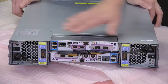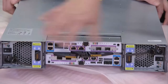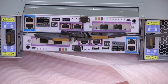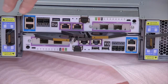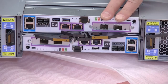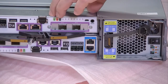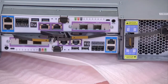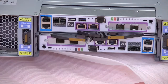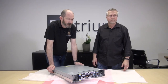So this is the business end — this is the connectivity. We've got dual controllers, dual networks, dual power supplies. These can basically slide in and out — they're also hot swappable. We've got management ports, 10 gig. I believe this one has the 25 gig Ethernet ports on it, so we have both SFP+ and 10GBase-T style connectivity for the data networks, and standard one gig Ethernet for management networks. And of course the IPMI interface for out-of-band manageability on there as well.